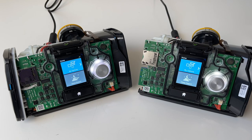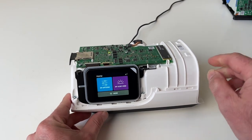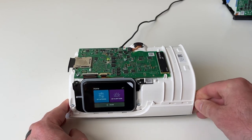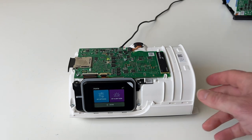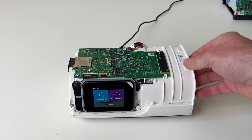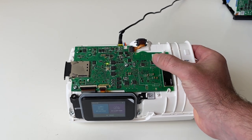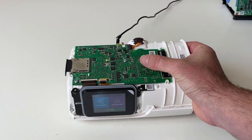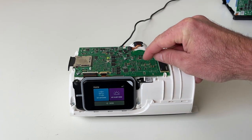All right, let's have a look at the AirSense 11 and I'll show you what's changed. Here's the AirSense 11 — it's pretty cool. I get a signal here in Australia. Sometimes when I've been importing AirSense 10s from the US, they don't work when they get here. But all the AirSense 11s I have seem to be hooking up fine to the signal. The problem is with this one — they've hard-soldered the cell comms into the main PCB. So here's the antenna and the cell modem — it's actually on the underside, right here. You can sort of see the square where it sits.